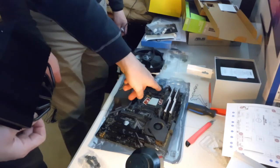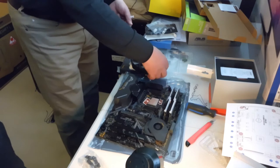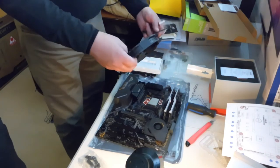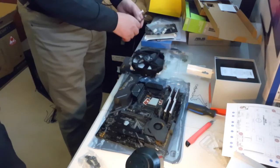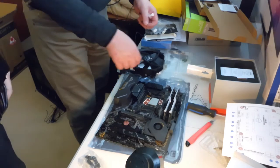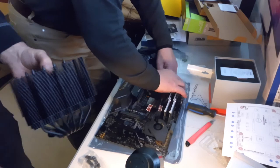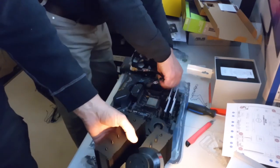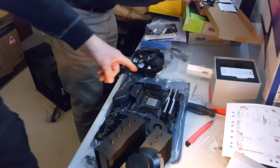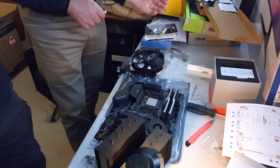Yeah, or straight into that socket, right? But you don't even need that. It's just extra length on the cable because this is going to sit up here. So you've got all this cable just making a mess. If it was me, I would take them out of there and not use them at all. I don't think they're essential in any way. You've got two headers here for two fans, so you should be able to just take that out and put the fans directly to that. Yep. I don't think there's going to be enough noise reduction to really matter.